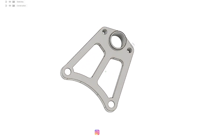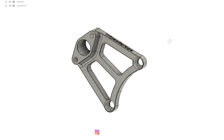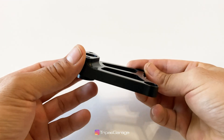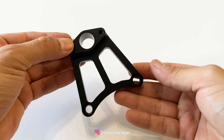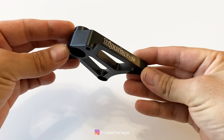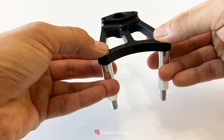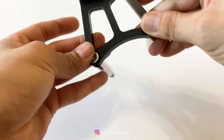The bracket in this video is not compatible with an OEM ECU as it houses only one camshaft sensor. As many of you know, the GE non-VVTi doesn't have any camshaft sensors on the head. So this kit allows you to bolt and adapt a camshaft sensor, allowing you to get a trigger pickup on your 2JZ GE, allowing you to run just about any aftermarket ECU you'd like.